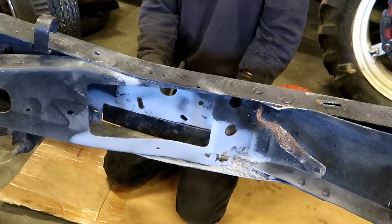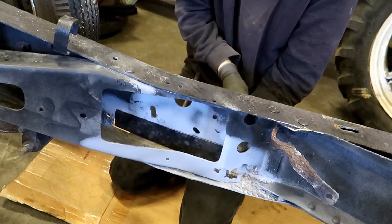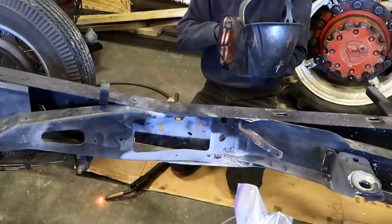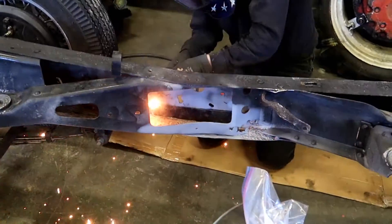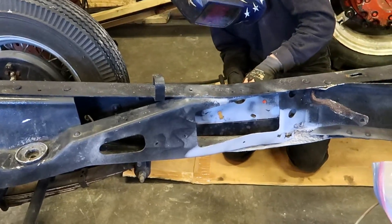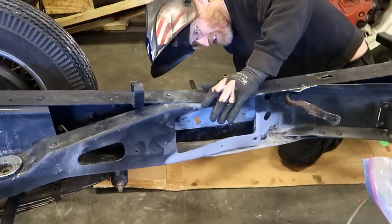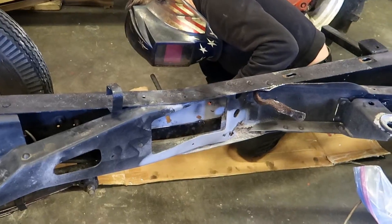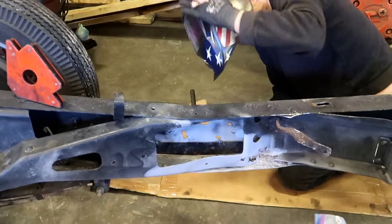As you see from some of these shots, we're actually welding the metal and taking our time to grind it flat so that it looks like the metal has never been replaced. To do a real good metal replacement job, you want to use the same size metal stock. You want to cut out all of the bad areas, then cut a piece to go back in, leaving a small gap all the way around so there's room for the welding material to fill the gap and get a good bond. You'll see that Alan tacks it in first, then goes through and does a series of smaller welds to let the metal cool down a little bit.